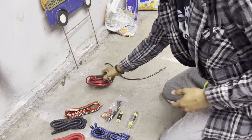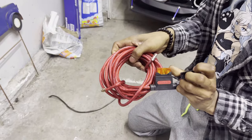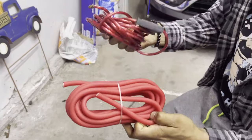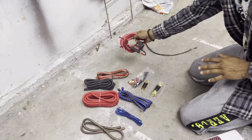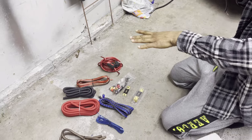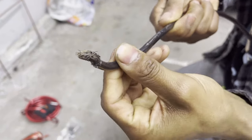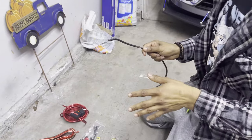This is what we started with — an 8 gauge with a 40 amp fuse. It's a big upgrade when you see the two side by side, but even so it was doing its job. It's nice to get that thicker wire and make sure everything's going to have current flow without risking burning. This was our ground — it did take a little heat damage over time from running too much power through it — so it's nice that we upgraded it now.